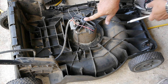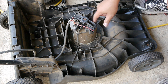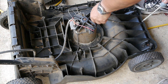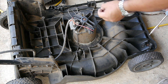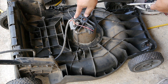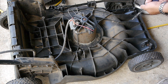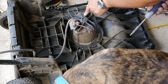Looking down at the motor here — I just kind of shook everything off but it still looks like there's some dirt and junk in there. I knocked something loose that looked like some burnt plastic. There it is — yep, broken. This here is the bridge rectifier. It's very common for it to go out. I'm not sure if this one has failed; once I clean this stuff up I can double-check. On each side you have a positive and negative — these are the housings that have the brushes on them.